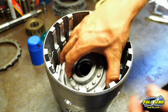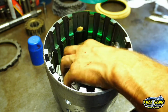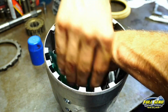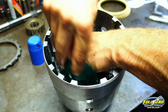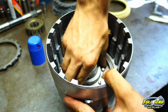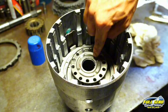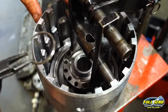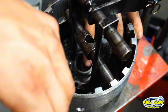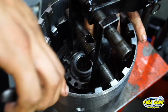After that, it's your overrun piston, and that sits in there just like this. This can be a bit of a booger. Lip seal tool comes in handy here. And you want to make sure this retracts. That's doing good. We've got to go over to the foot press and get this snap ring in place. I put these on backwards, like on the back of the snap ring pliers. And then I'll push back on the back of it with my left index finger and walk down.